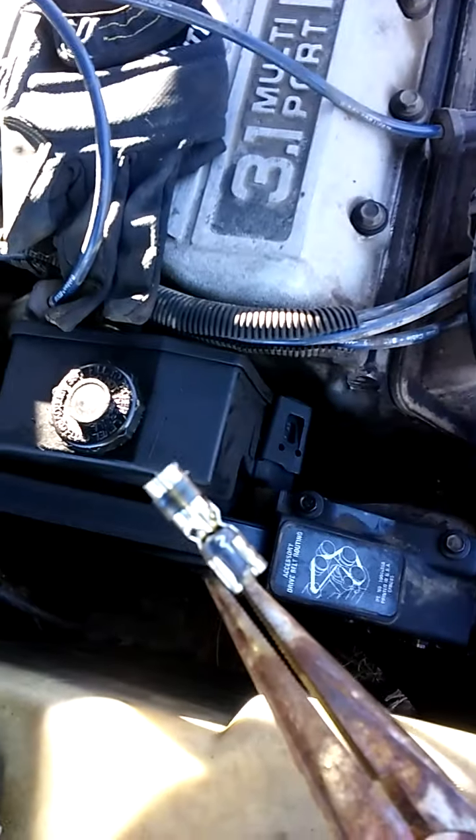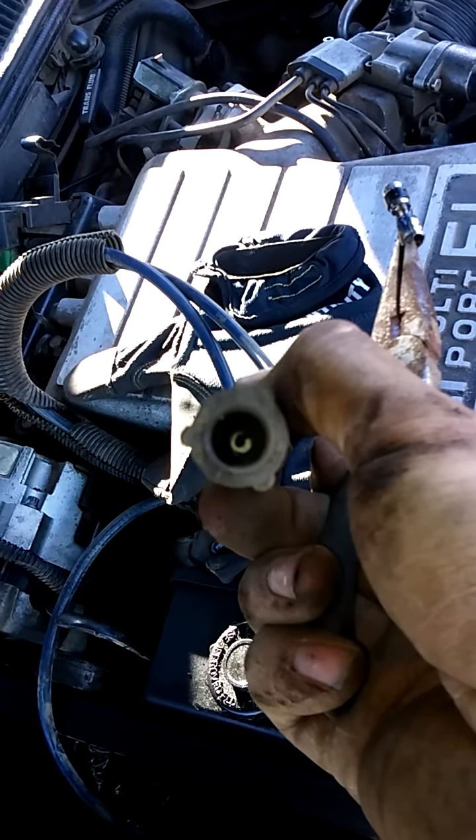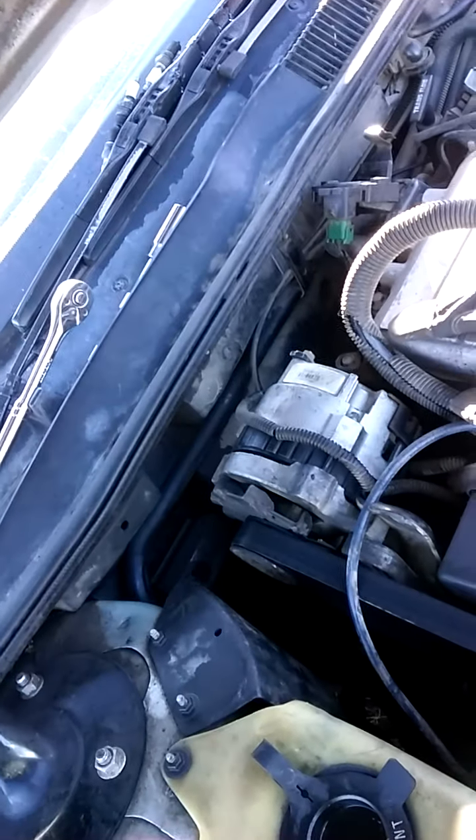All of these rear ones were cooked on to the point that they pushed out of the grommet — just verify it's broken and make sure you replace those in the process. Otherwise you won't be able to slip your wrench on to get it. This first one I had to use one extension, closest underneath the alternator. The middle one I used two, and it looks like I'll be able to use two on the last one also.